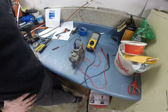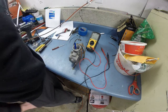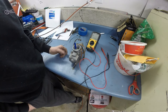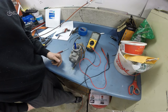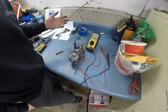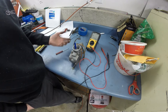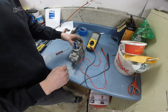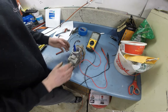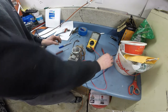What that doesn't tell me — since by the diagram it looks like this is hooked directly to like the engine kill switch — what that's doing, because just because you hold the sled wide open, it doesn't kill your ignition necessarily, but it must do something. I'm not seeing where it's connected to the CDI making a decision inside there. Anyway, we know that at wide open throttle, or even at half throttle or better, we have continuity, but when we're at a closed throttle condition, we do not.